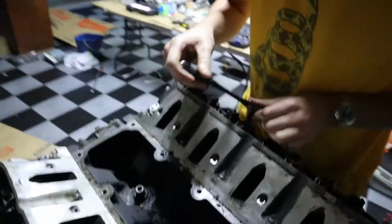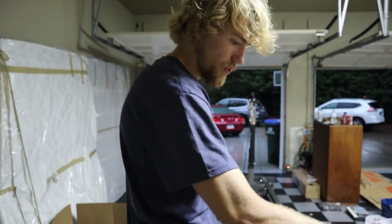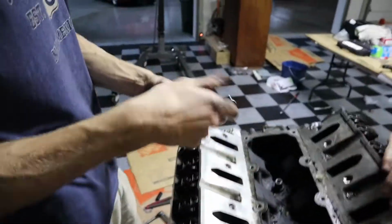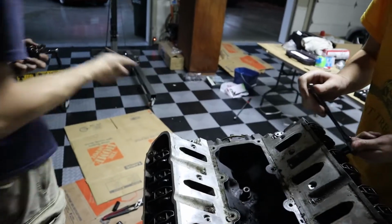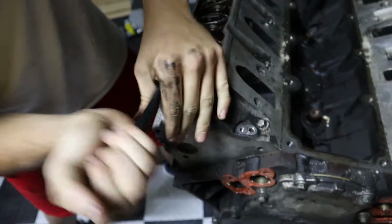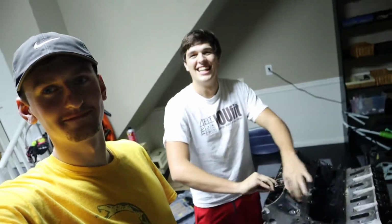Struggling. Yeah, it's struggling. Put these in a bag. Hold on, I want to get a crack at just one, just to see the tension behind this. Wait, we got to label these when you get them off. This is cylinder 1357-2468. Put the push rod and this in a bag and label it with whatever number cylinder came out. Okay. We'll do the same with the lifters. Oh, that one's on there, come on. Yeah, that one's on there. Holy cow. Oh, okay, there we go. Look at how clean this is. I'm just a weak link. We're okay.